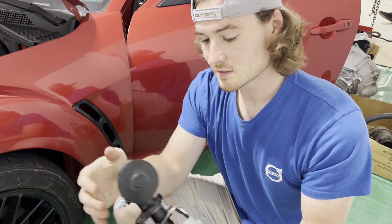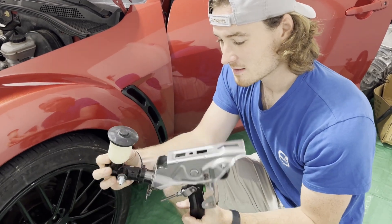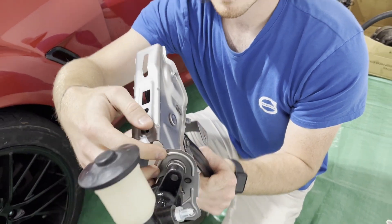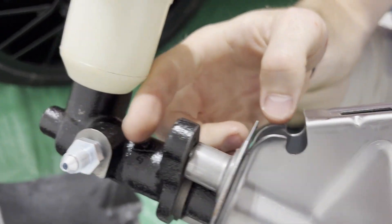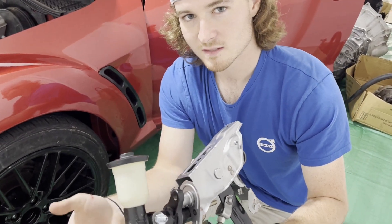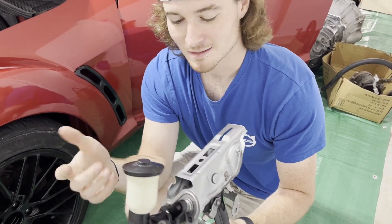All right, the one hole fits, the little hole fits. I was just test fitting this up so I could see what I need to cut. Originally my plan was to drill another hole in the firewall, but that would also mean modifying the whole clutch pedal assembly. What I'll do instead is just drill another hole in my master cylinder. The only downside is every time I replace a master cylinder I'd have to drill a hole in it, which isn't a big deal.